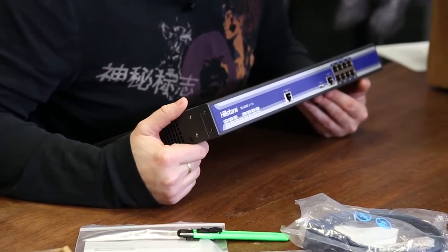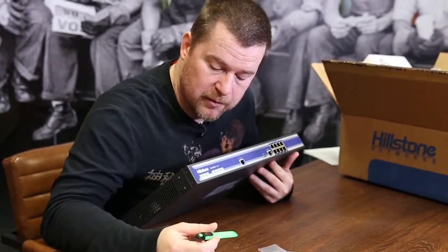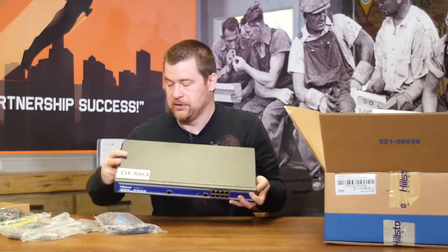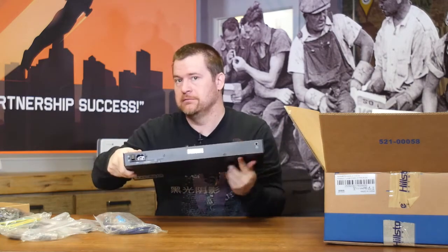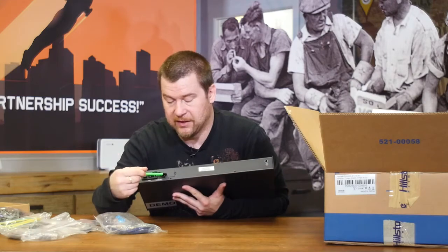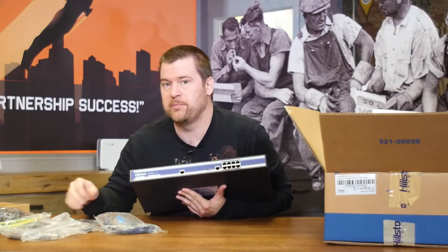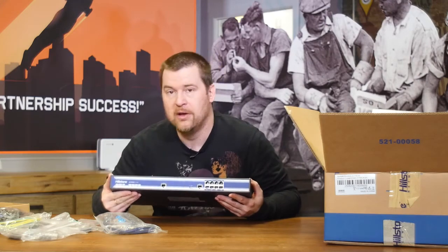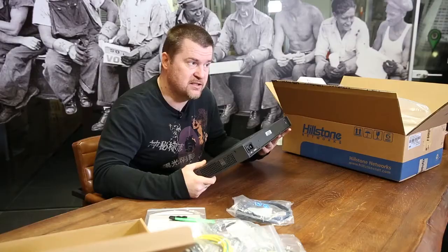Usually firewalls just have a couple of lights and don't have an LED for each port. This appliance has one power supply, so there's one LED for power, plus additional LEDs for alarm and status. You can actually add a second power supply for redundancy — when you do, you'll see both LEDs on the front. That way, if one of your power sources goes down, your firewall will not go down. If you use two power supplies, the tip is to connect one to a UPS system and one directly to the power supply system for full redundancy.